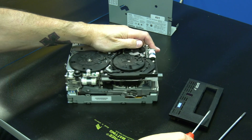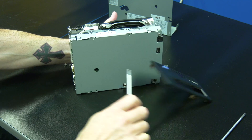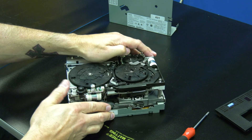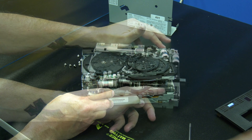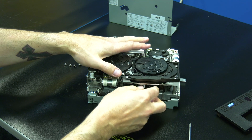This will disengage the arm from the rear spool and begin feeding the tape leader around towards the front of the drive. As the slack on the tape leader is let out you will want to stop occasionally and put the screwdriver into the bottom hole and engage the front spool and pull the additional slack into the cartridge. Once the tape leader is in view you can take a small screwdriver and pop the barbell off the leader of the arm, freeing it.